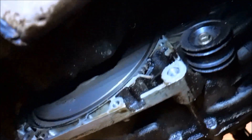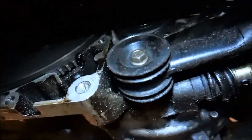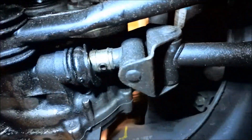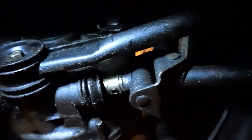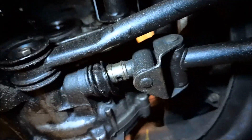Get the rest of your brackets and proceed on breaking it down. I got both brackets out, I got the shield out, and I got the half shaft out. Next up: those two T-bracket bolts, stabilizer bar, shifting bar, 12mm bolt, and the roll pin. After that, it's just bell housing bolts above and on the side, and it's ready to drop. Oh yeah, and the trans mount — but that's obvious.